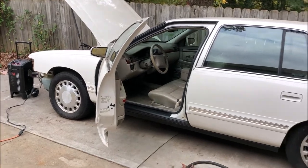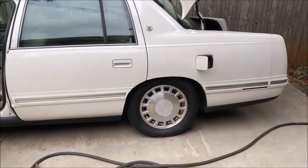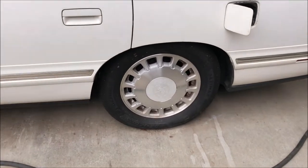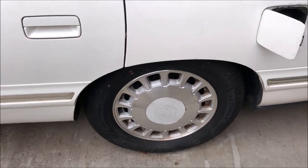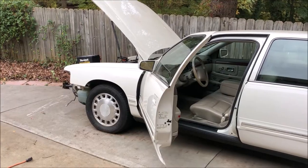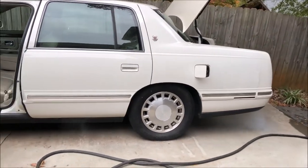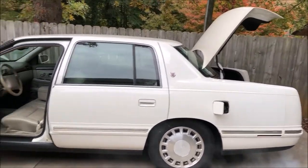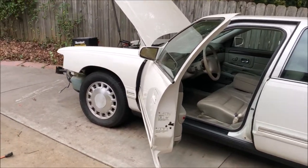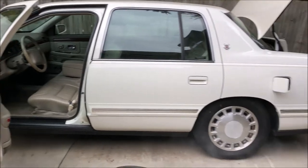I've hooked up a mobile battery charger — I've got it on 25-amp charge and it's actually filling up the rear suspension, you can hear it slowly but surely. With the car running, the back end is level, so that level sensor is working properly, which indicates that the controls in the vehicle other than the sensor are also working properly for level control.